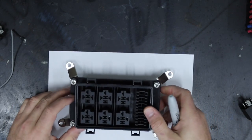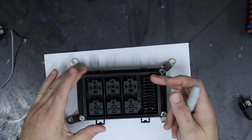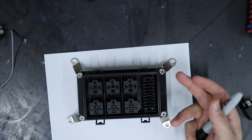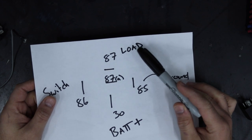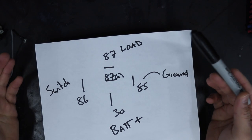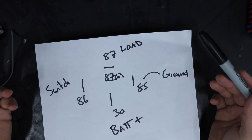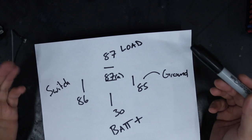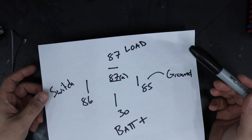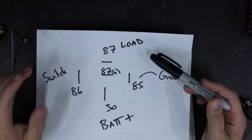Now let's talk about a relay panel. It's just six of those things we talked about. And fuses. Why do you need fuses? Well, each thing you're powering, each Santa, is gonna have a different need. A light up Santa may only draw 5 amps of energy. I think most of you guys understand that amps mean sort of the force with which electricity travels, okay? It's not technically correct, but just work with me.